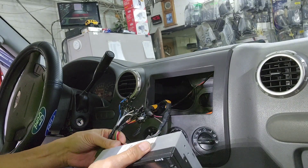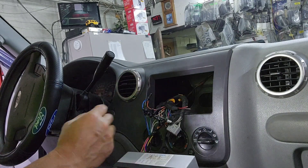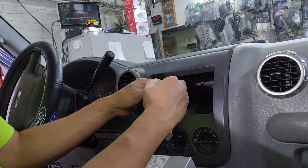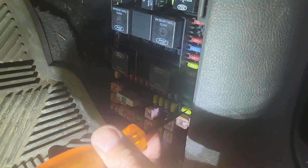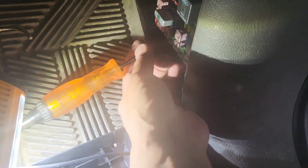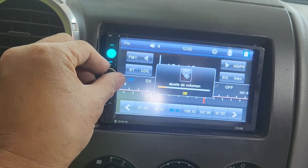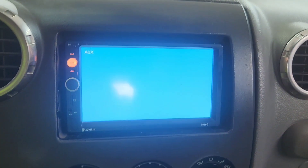I'm just going to plug it in right now — it should work after I find the plug for the fuse. After testing the fuse, one of these is blown right there. This is the passenger side — you see, this is 12V with the lights on, and the other side is off. So I tested it; it doesn't say anything here so I replaced it — put another 20-amp fuse right there and it should work. And the result — everything works! Just making sure everything is good. Alrighty, that's it! Thank you.